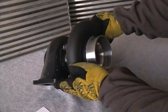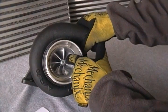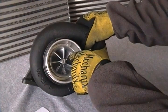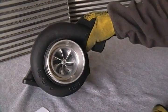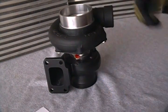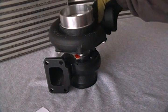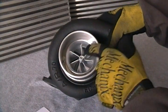So what we did — you can see here — we changed the angle inlet and readjusted it so that there was a bit more lead splitter blade of the inducer going over the secondary blade a little bit more, giving us a slightly higher rotational speed compared to the previous generation. This means there's a smoother transition of air entering the inlet, which is then converted into pressurized air as it goes into the intercooler.